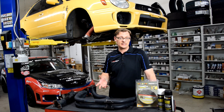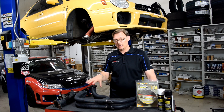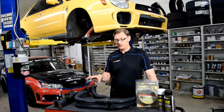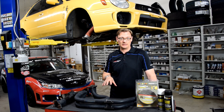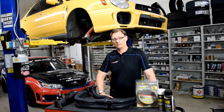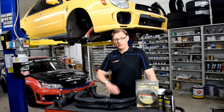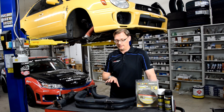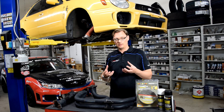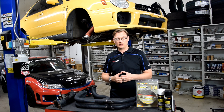For comparison's sake, the stock header is made of cast iron and it's got a ton of heat shielding on it. That's for two reasons: one is to keep the heat in the exhaust so you get a little better performance out of the turbo and the car, but also to keep the heat out of the engine bay. A worst case scenario would be to just put on a bare metal header — just a stainless pipe with no amount of heat mitigation on it.